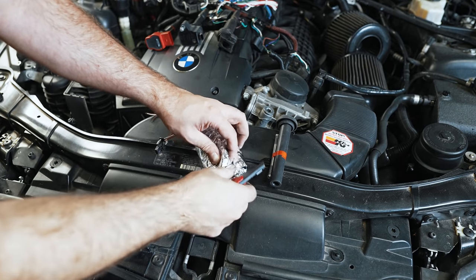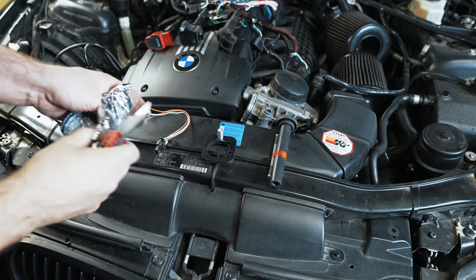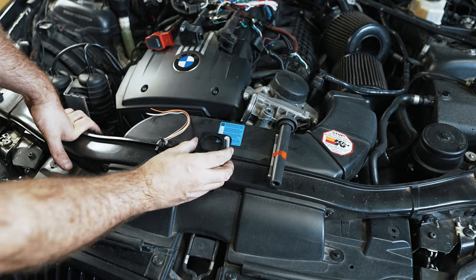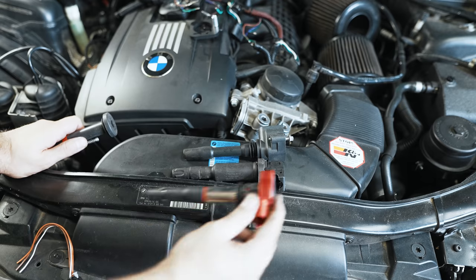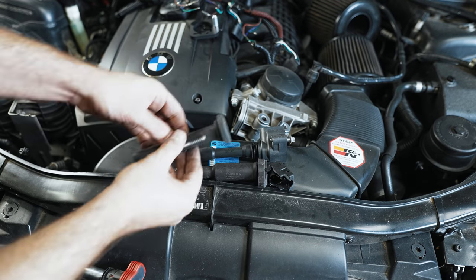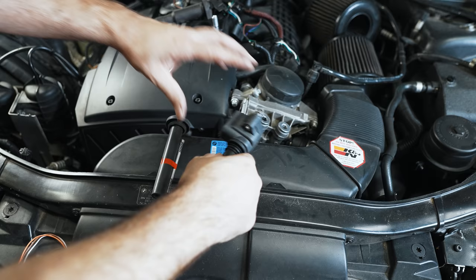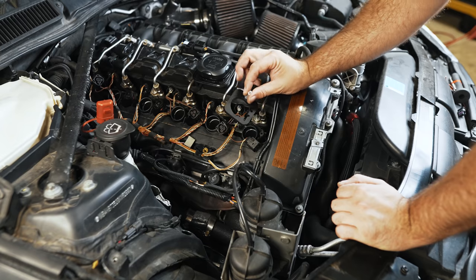Let me show you the kit I bought. There are a few conversion kits out there to run B58 coils on N54s - it's a relatively new idea. I went for one that I thought was most cost effective and the cleanest looking. This is an adapter plate - not one big plate, just individual plates that you screw to your valve cover. It's called the Fat Bunny kit; I'll put a link in the description. Right now it's a little over $200 shipped. It comes with a new boot - the B58 coil is a little short by itself, but when you add this boot it becomes about the same length as your original coil.